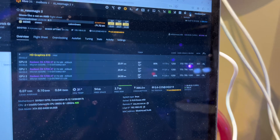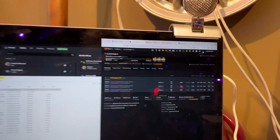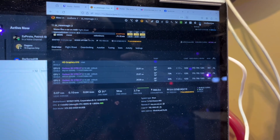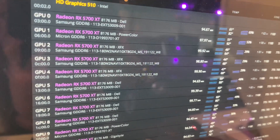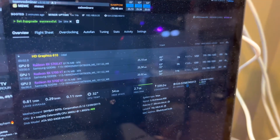Unfortunately I lost track of the screenshots so I can't really compare, but it does look like the temperatures are better. The third one's not perfect, so I'm not sure which card that is, but I'm actually very impressed with how well they were performing with bone-dry paste before. I'm going to throw the other three in the big Octaminer, and then we'll start throwing the XFX cards in three at a time. We can see where I took out the ASRocks and put in three of the first XFXs - they are all working just fine on Ergo on that X12, which is great. I have the first three Triple Dissipations in here, fans are all working great, hash rates are good, temps are good. I'm pretty happy with that overall.